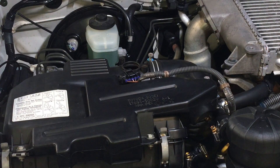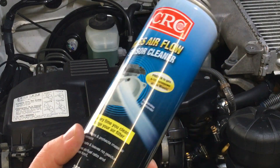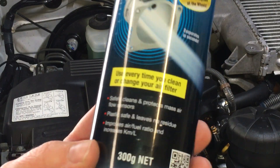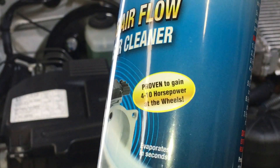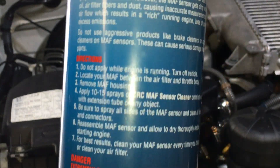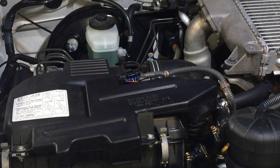I use the CRC brand - I'll show you. It's probably just like any other electrical components cleaner. You can press pause to find out what's in it - it's going to be probably the same stuff. You can buy a $3 or $4 can of circuit board cleaner type thing. To take it out, there's two screws and a plug. Once you've got it out, you give that a clean, and we clean out the hole with a rag.